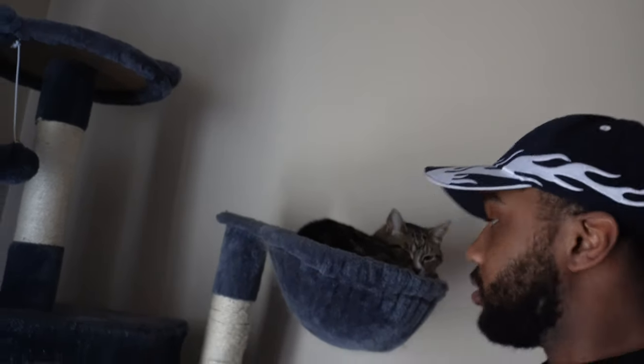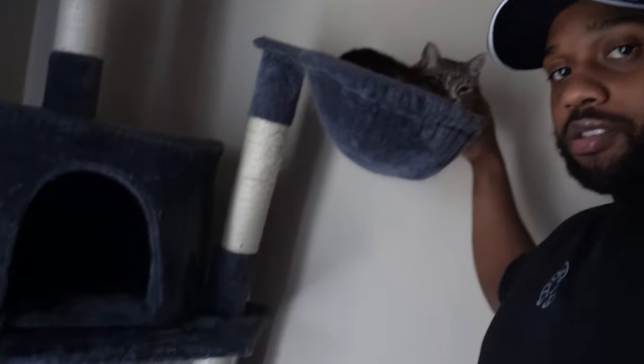Let's go inside real quick while that warms up. Come over here - big Twizzy, what's up? She's about to sleep in her big cat tree. Update: there's air in the system so we're going to bleed it. I called about my trunk tank and they said the simplest way to bleed it is to take the top off the trunk tank and let the car run - all the air bubbles will come out the back tank and bleed itself. That's a relief, because on the stock LT4 blower it's a long process with the bleeder valve.